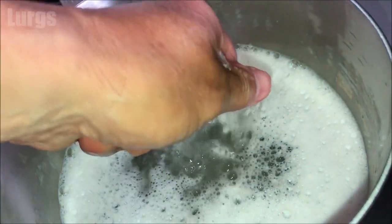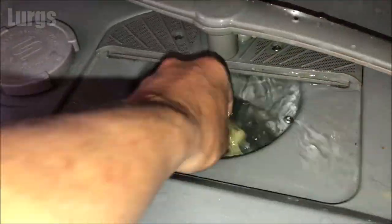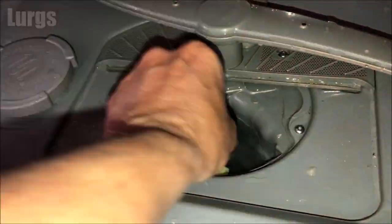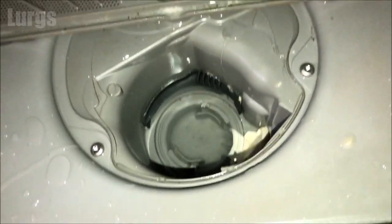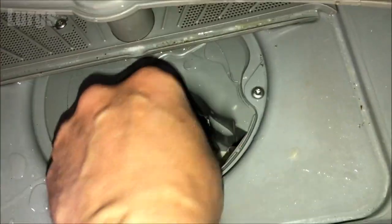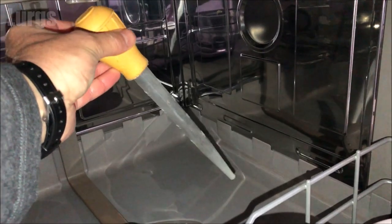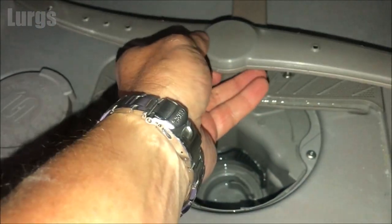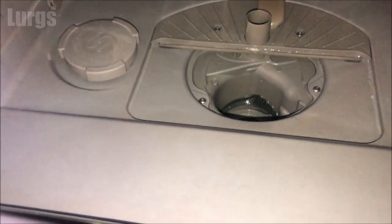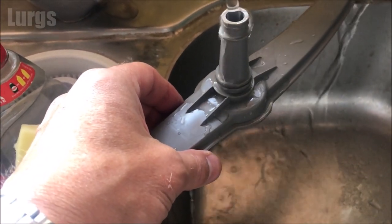Take your sponge and drain this water — this is where the impeller is, which does the actual drainage; it spins round. Get as much water out as you can. When you get near the end you can use one of these turkey basters to get rid of any excess water. You can also remove the lower spray arm for easier access — that just pops off. Give it a quick clean and make sure water is flowing through it easily by running the tap through it.